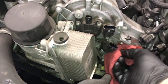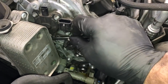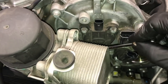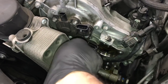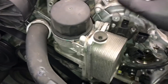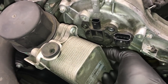If you look inside the cam, there's a little spout sticking out. The adjuster pushes on that and opens up oil passages, allowing oil to flow into the cam adjuster and change the timing — kind of like variable valve timing on a Honda. Now the fasteners on the intake adjuster are behind the oil cooler, so I'm using an 8mm E-Torx wrench made by VIM Tools — I'll link it in the description. Once you crack those free, spin them out with your fingers. There's just enough room to get your fingers back there and remove the fastener without taking off the oil cooler.